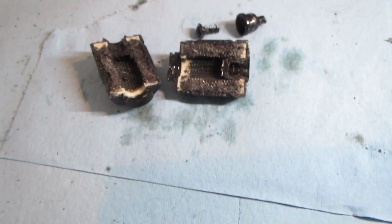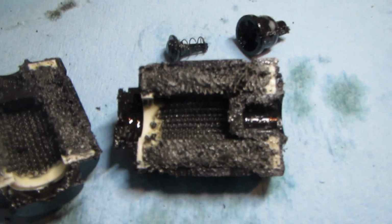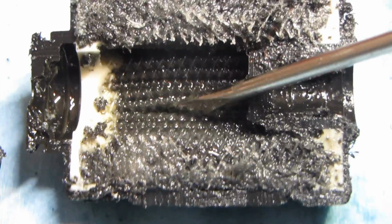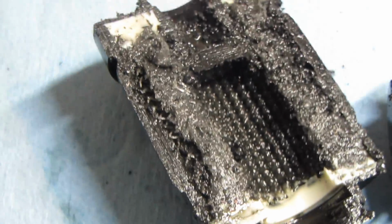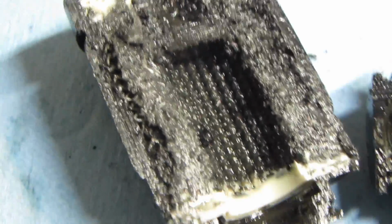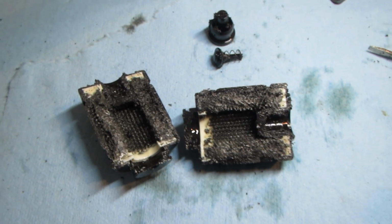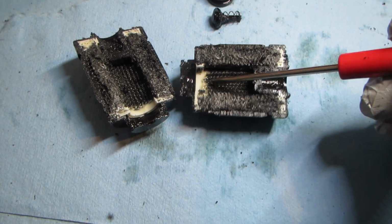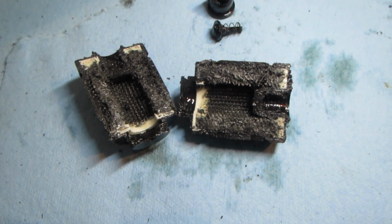Tell you what. Let's take a look here. There's your filter media. You see it in the pleats. This is a proper skookum filter. There's media. There's a bypass valve or pressure relief valve there, it looks like. Yeah, so this is a proper filter, more than just a simple screen. So replace it. You can see mine is very gray. Very gray. And this looks like it was white plastic or white material that holds it at the ends. I'm going to do a little more disassembly and then come back and show you what the media looks like unraveled.